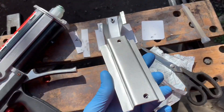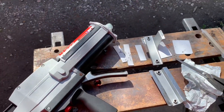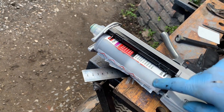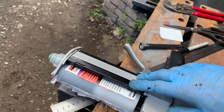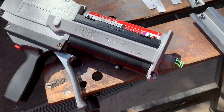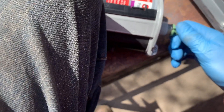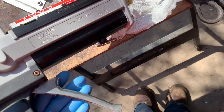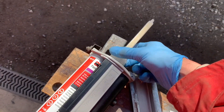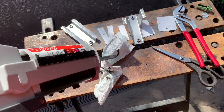We're ready to put our primer coat on. We're going to be doing the battery brackets we've made up as well, so we need a primer coat on those, a primer coat on the piece we've made up, and a primer coat on the car. A good idea is to take the wrapping off the glue so you can see exactly how much you've still got left — as you can see we've only used half of this tube, which means we should be able to glue on that inner wheel arch support panel as well. Last time we used this was two days ago, so I'll be interested to see if we can get this plug out and whether the glue is solid. Looking good — we're just going to put on our new nozzle, these are one-time use nozzles, and we'll just lay a bead and make sure it's mixing as it should.